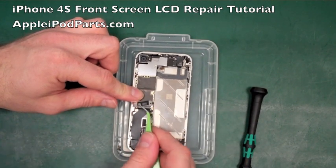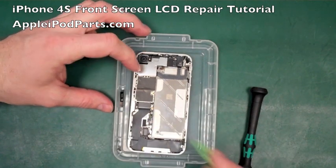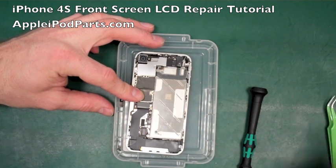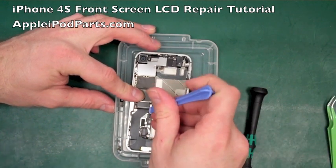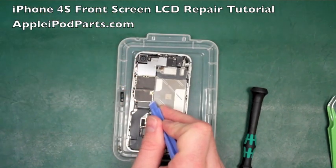This phone's never been open again, there you go, that's that plate that comes off. Exposes the dock connector socket there, and that's the dock connector that comes all the way along under this speaker. Pop that connector off. Again, when you come in using a non-marking tool or a spudger, I mean we do the spudgers on our site as well,